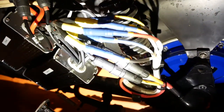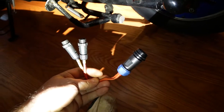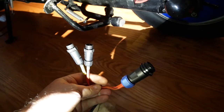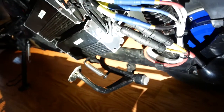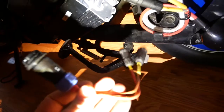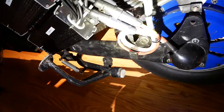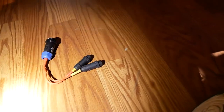Originally how I built this thing was a little bit different on the other motor. All of the halls coming out of the motor and the temp signal — which was a temperature switch, not a temp sensor — all came into one connector, and then widened out up to two controllers which already had these two IP68 connectors on it. When I pulled that other motor off because I cooked the halls in it, I wired this one up and thought, that's stupid — why do I need this Y-cable thing? Why not just put the connectors right on the end? So that made more sense; it's simpler, less work. That was the end that plugged into the controller and that's the end that plugged into the motor — anyway, gone. Lots of extra effort for essentially nothing, so this one doesn't have that.